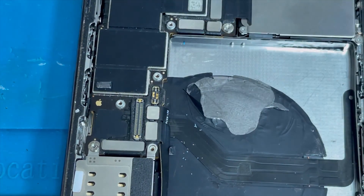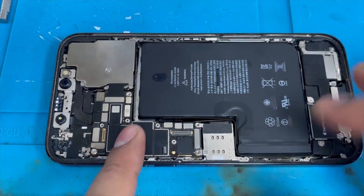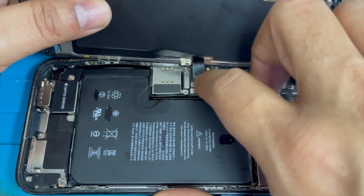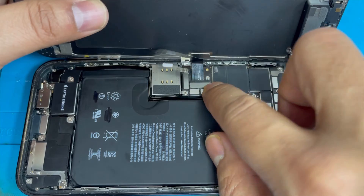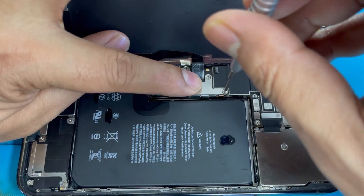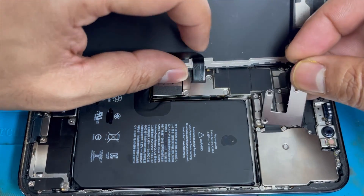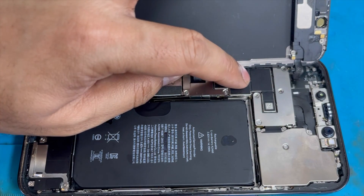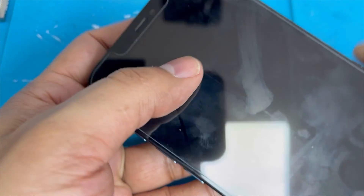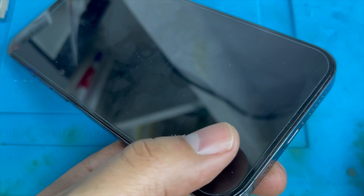Connect the wireless charger port connection. Now put back the battery — you don't need extra glue, the previous glue is still good. Flip the battery back in. To install the screen, first remove the battery connection, then install the screen connection. Here is the speaker connection, then connect the battery. Put back the bracket plate with four Y screws. We're done — we didn't need new adhesive tape, the previous glue was good. Put back the screen and install the two bottom screws.